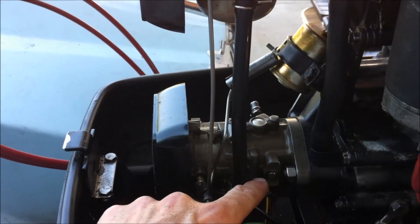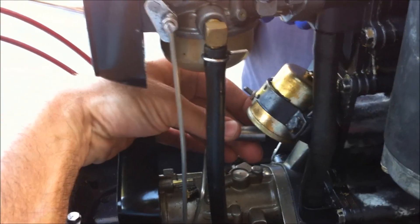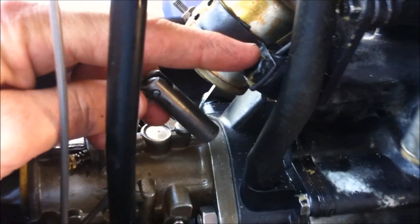Just make sure when you're putting your carburetor unit on here that you slide this in when you put it into the automatic choke — the solenoid, or whatever you want to call it. Because we didn't do that, it means taking off this bracket here and sliding it back and repositioning it.